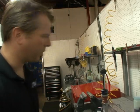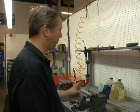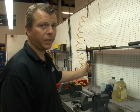The first step you're always going to take is to look at spring rates first. Spring rates are going to be based off body weight, how much the quad weighs, whether you're going plus-two or plus-one A-arms, or minus-two swingarms. You always need to tackle the spring rate problem first. Once you get that done, you're going to go after the internal damping to suit both the spring rates and the type of riding that you're doing.